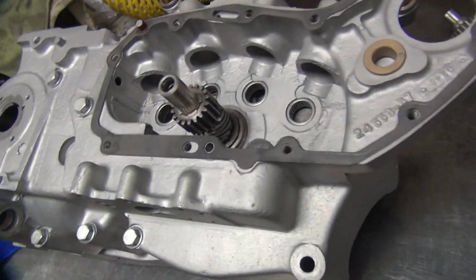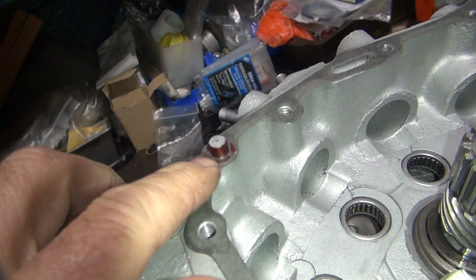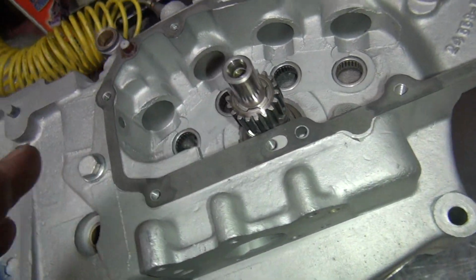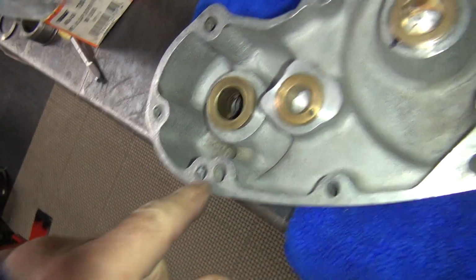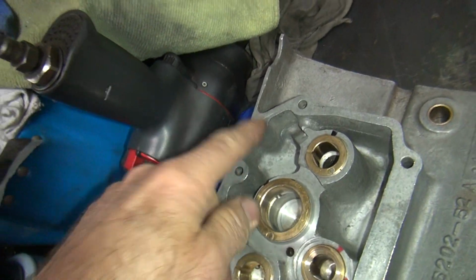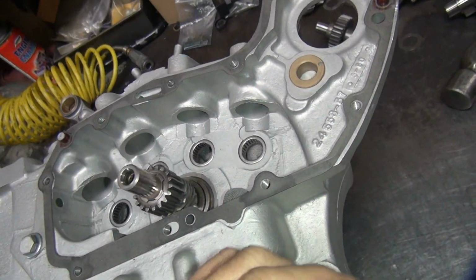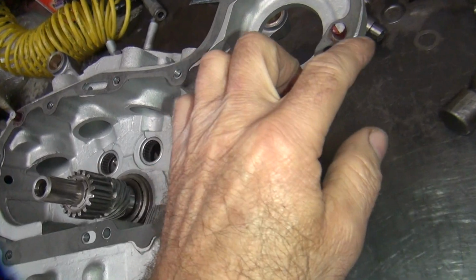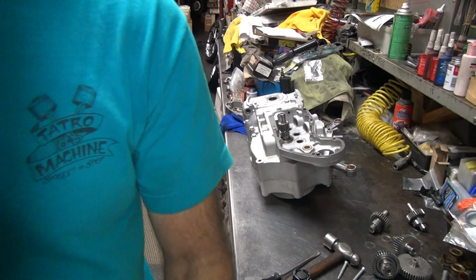Okay, back on this motor. I went ahead and filed the high spots and dowels here, remarked them so they're good. Open up the dowel pinholes on these a couple thousandths. I can still go a couple more if I need to, but I don't want to go any more than I have to on that, obviously. So now everything looks like it's ready to go back together again. See if we can't make this thing work.